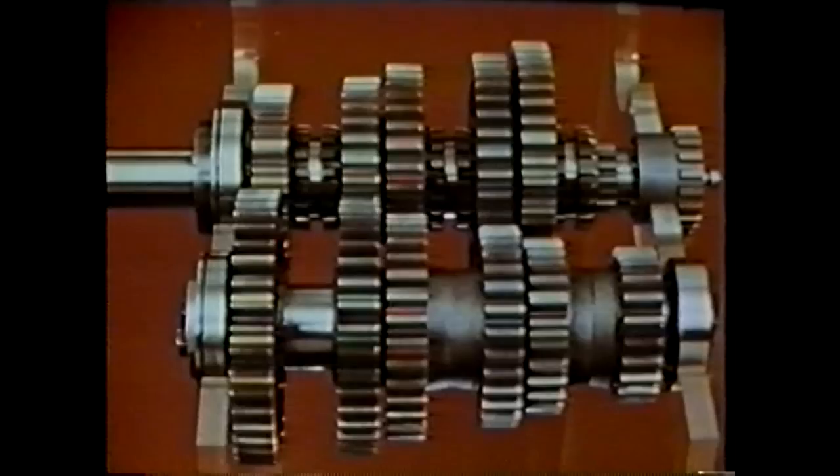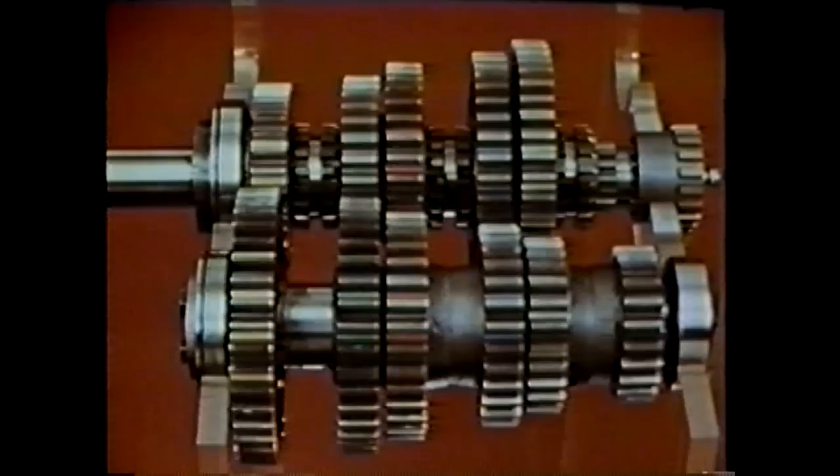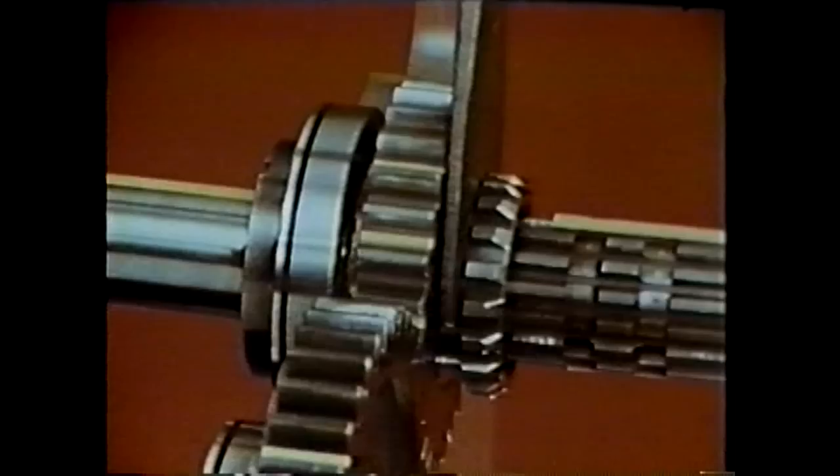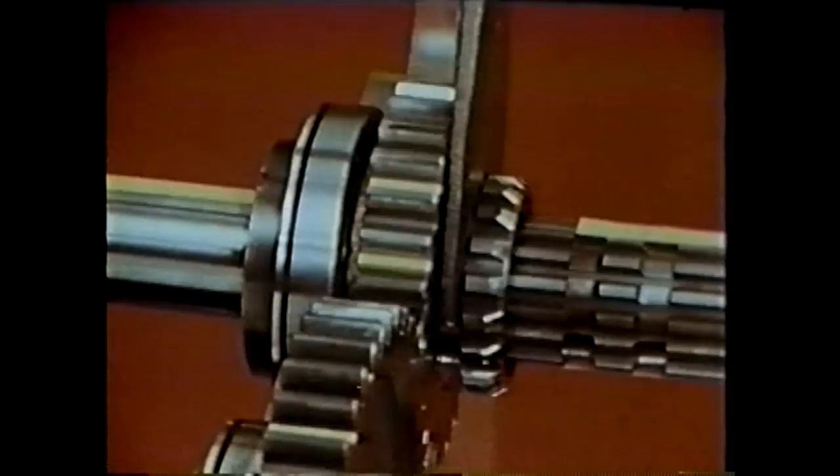We continue to add gears to complete the transmission. Third gear, coated in red, is to the left of second and uses the same sliding clutch. The clutch disengages second, moves to a neutral position, then continues to engage third. Fourth gear, coated green, and fifth gear require adding another sliding clutch. In this transmission, fifth gear is direct drive: the sliding clutch locks the input shaft directly to the main shaft so both turn at the same speed, with the counter shaft simply idling.